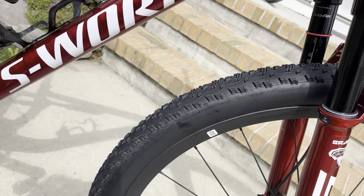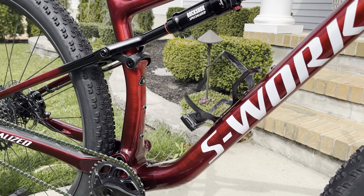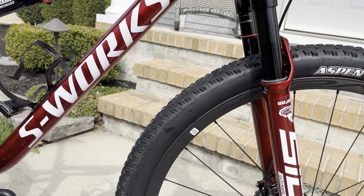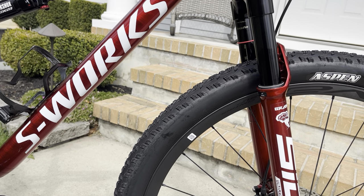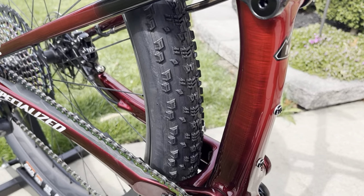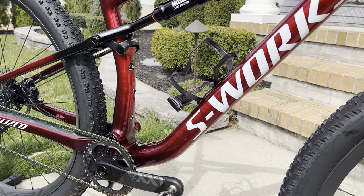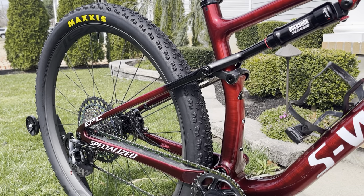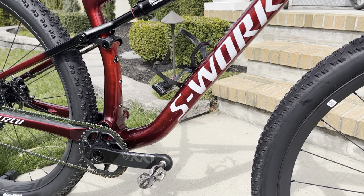I'm just blown away by the traction these skimpy tires provide. I've only had a few rides on them but the initial impression is way better than riding the Renegade in the rear. These tires have been around forever and are used by top pros, especially in the wide trail version, but you need to check frame clearance — Maxxis' website lists frame manufacturers that confirm clearance, and you need at least 6mm at all points. I'm running 19 to 19.5 PSI in the front and 20.5 to 21 PSI in the rear at 175–178 lbs rider weight.